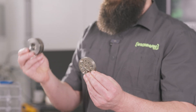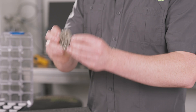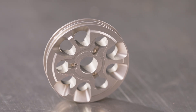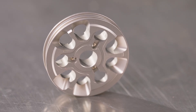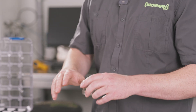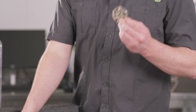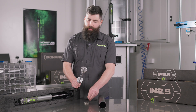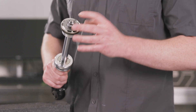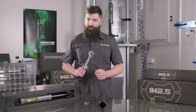Let's start with the main piston. This is a CNC billet aluminium piston — we've optimized the flow paths to really enhance the ride comfort, with additional porting for the bleeds to ensure that lovely low speed control. To put it into context, here it is on the end of the rod, housing the shims and the sintered Teflon band.